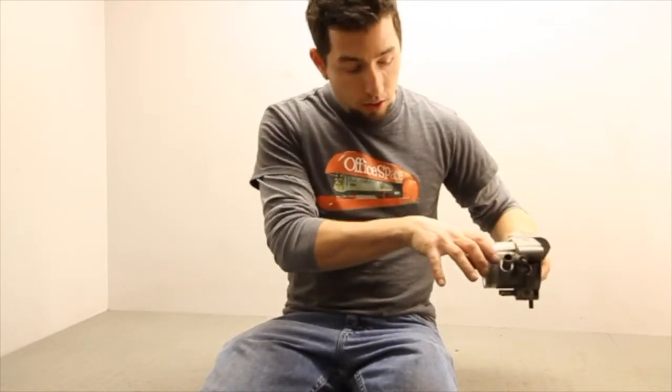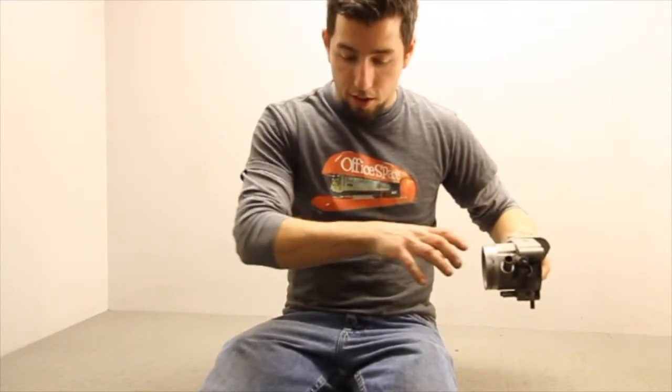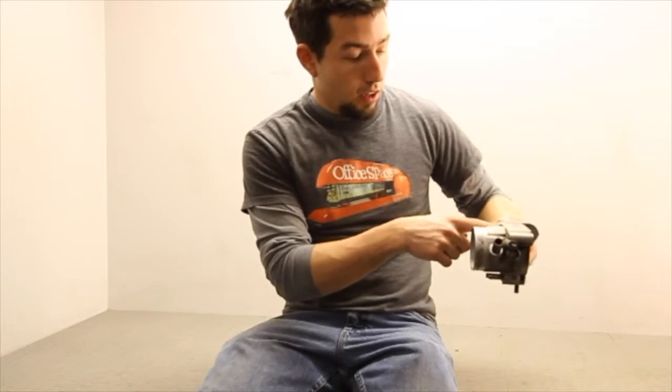So if it's mounted like this in the vehicle, you have your intake tube that clamps on here and it goes through your air box with your air flow meter. You want to pop the clips loose on the top of the air lid, disconnect your air flow meter and take the clamp off and remove that. The next thing you want to do is pull the air box bottom out — I believe there's one 10 millimeter that holds that in. Once that is out, you'll be looking at the throttle body.